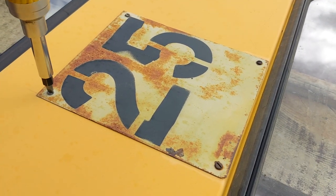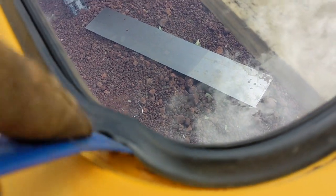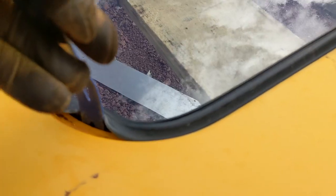This plate is just super cool — I love the patina on it and they'll use it inside the bus somewhere else. Now I'm getting under this rubber molding with the pry bar. You've got to work your way around; it's a little tough to do one-handed, so just get under that and pry it around from the same side as the locking strip.